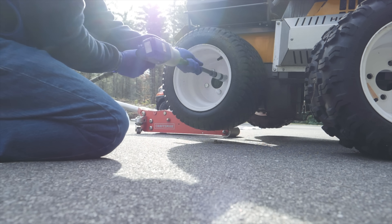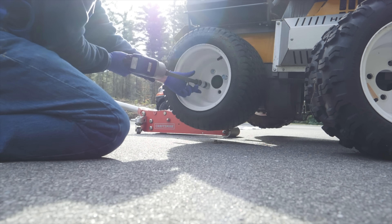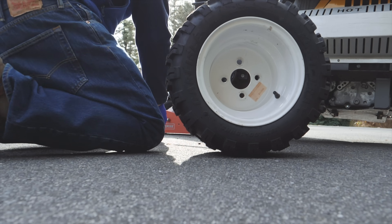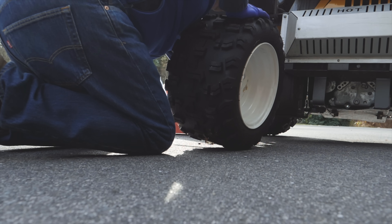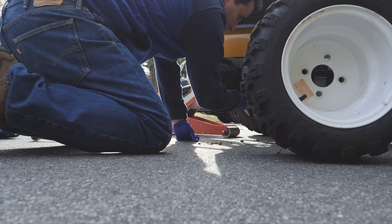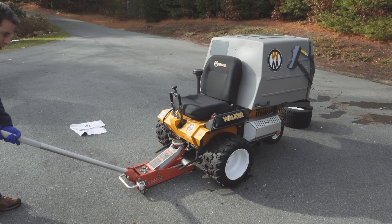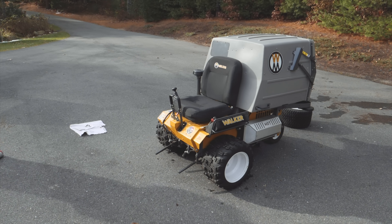Now I'm just working on the other wheel to do the exact same work on the opposite side. I'm going to put the wheel spacer on and then I'll put the snow tire on as well. I've got both wheels mounted so I'm going to lower the jack. I didn't tighten these wheels up all the way — when I'm all done, I'm going to do one final torque. I just didn't want to do it when it was on the jack in case it would fall.